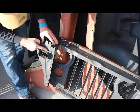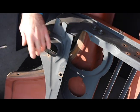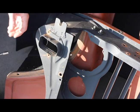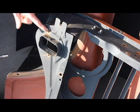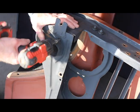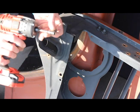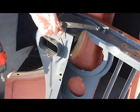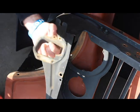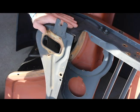And then all we need to do is take off this air vent — this goes into your air cleaner and you've got the accordion type air vent that runs into this. Mine hasn't been on there for a long time. One of the screws has been taken out; I think that might have been part of the ground screws from the previous removal of the grill. This is a 5/16th inch screw. Then you have your air vent cowl, or gasket if you want to call it. And at that point, you've pretty much taken apart your whole grill.